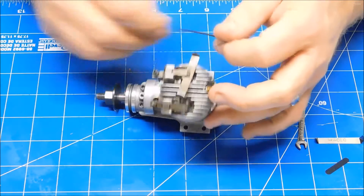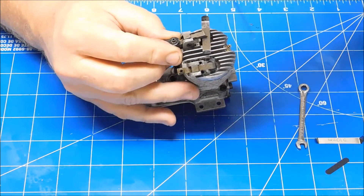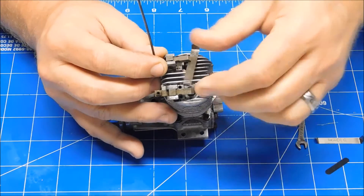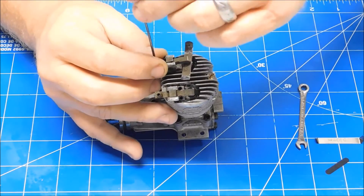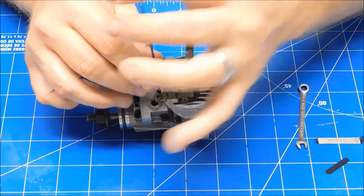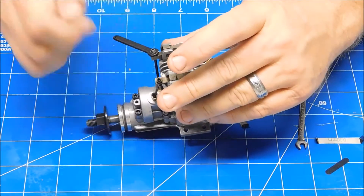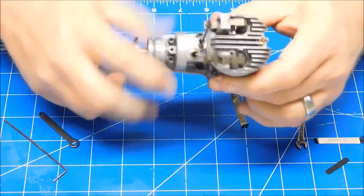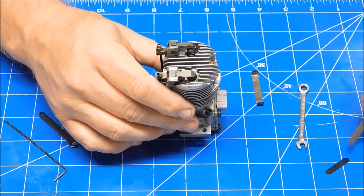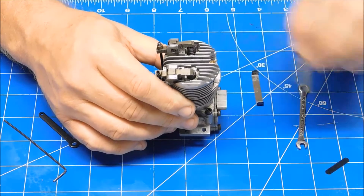That's a little too tight there, so I'll go back, put the spanner on again, and open it up. It's still too tight — I'm going to open it just a hair. About right there. Right there it's just starting to nip it. There we go — I feel just a little bit of tension. I always do one valve at a time, then rotate it through a few times, get it back to that point and test it. The .1mm is not really going in there — I can force it but if I just lay it in, it's not really going in. So that's good.